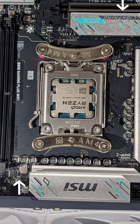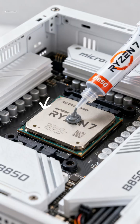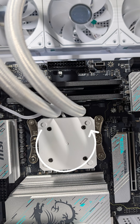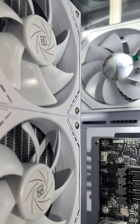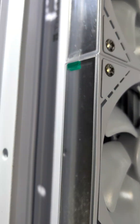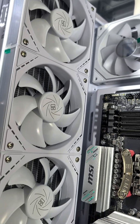Next, the cooler. We install the mounting brackets onto the CPU socket, apply a pea-sized dot of thermal paste, and secure the pump head nice and snug. Installing the radiator and fans is a tight job — you have to thread it carefully past the cables and ensure every screw lines up. In a Micro ATX build, every millimeter counts. Take your time here for proper airflow.